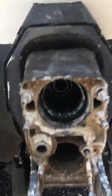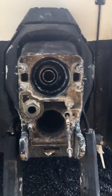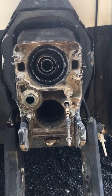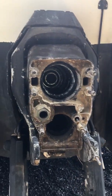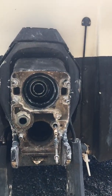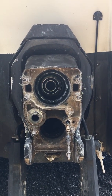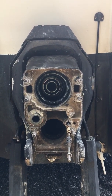Hey everyone, today I'm going to show you how to align an engine that is really badly off. The reason why this alignment is important is because you damage your coupler and your gimbal bearing. The gimbal bearing is one thing to replace, but the engine coupler requires you to remove the engine and it's fairly expensive.